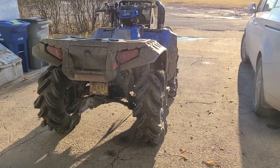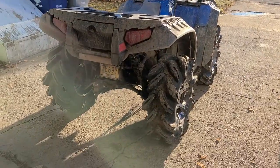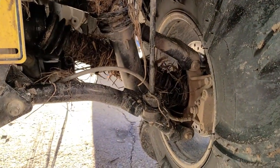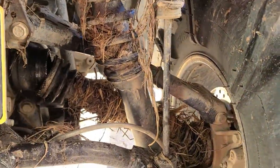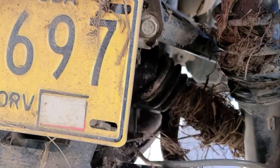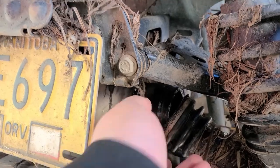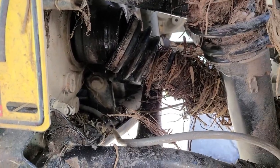First things first, we'll have to get the bike jacked up and get it on stands, get this tire off. It's pretty straightforward. Unbolt the A-arms down at the bottom here, and once they're loose and out of the way, the axle — well, this outer piece — should just fall right out, because there's nothing really holding it in there. And then hopefully we'll pop out the inside piece, and then just reverse the process with the new one.